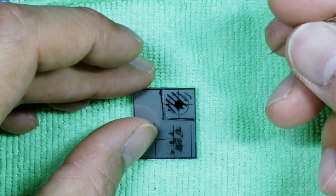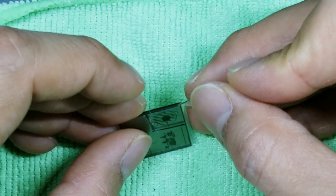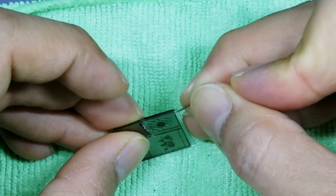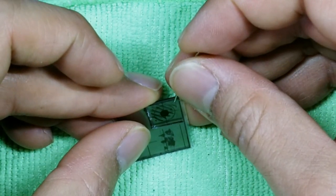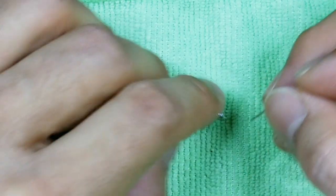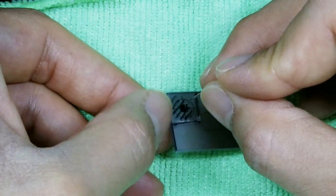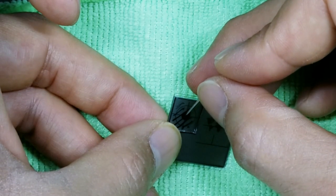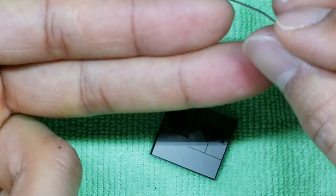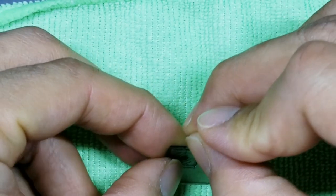Start here with the display like this. Put that pin at the very top between the top layer and the middle layer. You can feel where that is and push the pin inside. Now, how you can find the correct layer is you can kind of take your pin here on the display, drag it slowly until you feel it fall off the first edge and land on the second edge. That second edge is going to be here, and that's going to be the middle layer. So drag it slow. Okay, I felt it drop, and then kind of push the pin down.